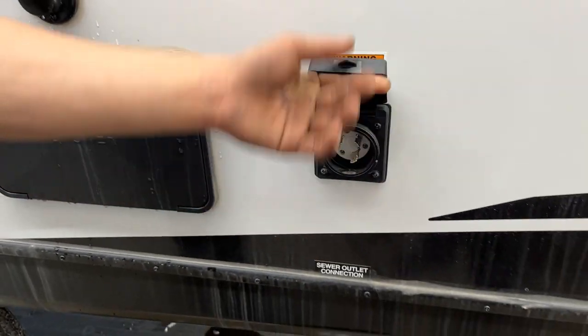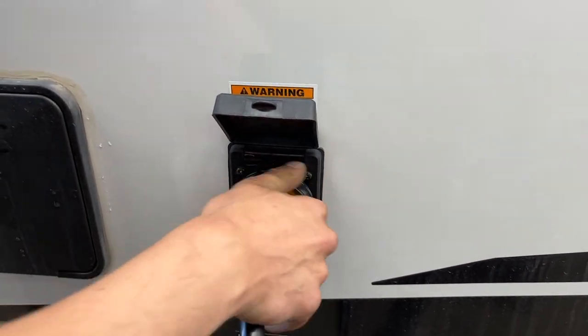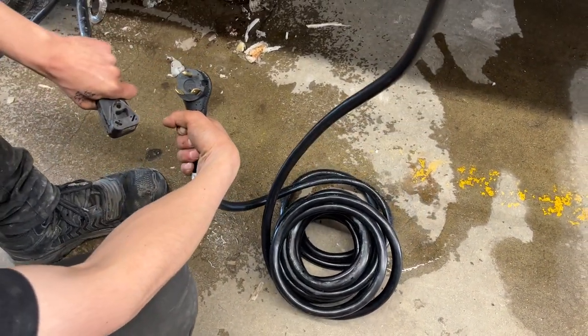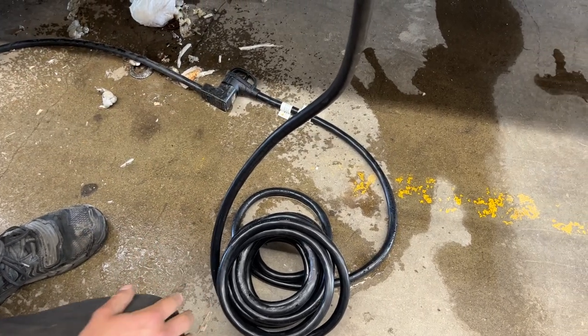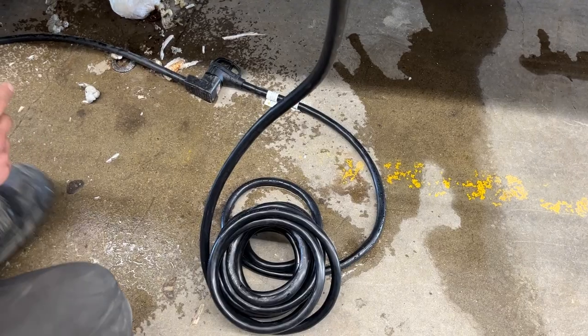A couple of steps forward, you'll find your power inlet. As you pop that open, you get a little notch in the bottom corner that lines up with the notch on the plug. Press those in together, give it a little turn to lock it down, then use the threaded collar in the back to properly lock it into place. Following the cord back, you'll find a standard 30-amp end — most campsites have that, so you can plug straight in. We also provide a 15-amp adapter so if you're looking to plug in at home to charge your battery or run your fridge, you've got the power to do so.